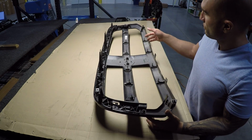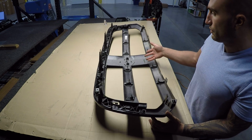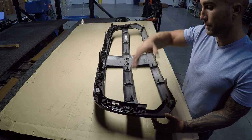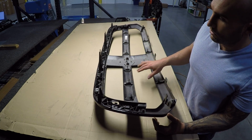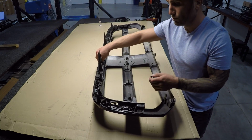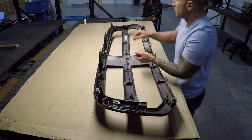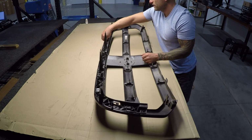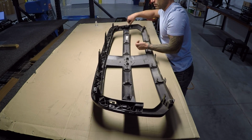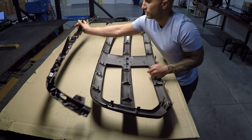Okay, so you can cut it from the front like I was doing on the other side, but this bracket kind of gets in the way. You can already obviously tell I've removed the grills in another video, so check out that video if you haven't seen that already. And the emblem's removed, again, another video on how to remove the emblem. So those two steps are out of the way. I also show how to remove this, but basically it's just a bunch of 8mm bolts. These are already loose from my previous work, but just take these 8mm bolts across the top out, and then this top bracket will come off. It's pretty much just hanging here. So this bracket will come off, and it won't interfere with what we're trying to do here.